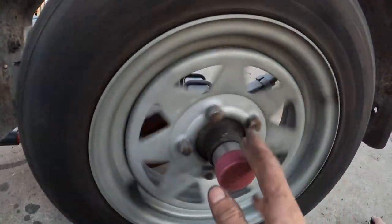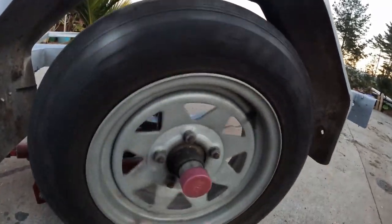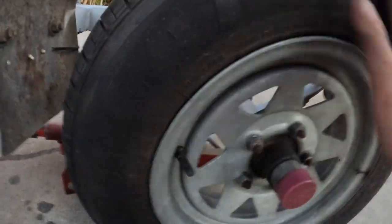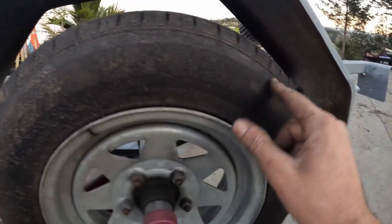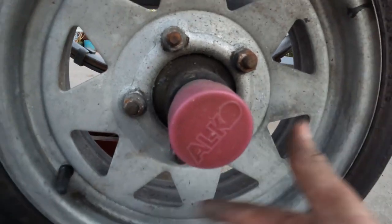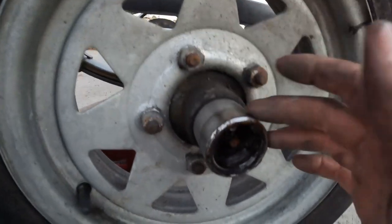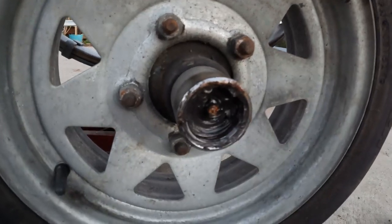When the wheel bearing fails, I have seen tires, hubs, and all sorts go wrong — they have come off on the highway. You don't want that happening. Pretty easy check: go around, give it a bash, and check for any cracks in your sidewall. On a WoF inspection in New Zealand they'll fail you if there's cracks on the sidewall. I have bearing buddies on mine — that's just a little silicone cap.